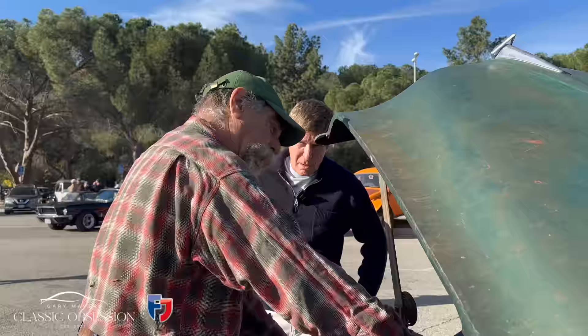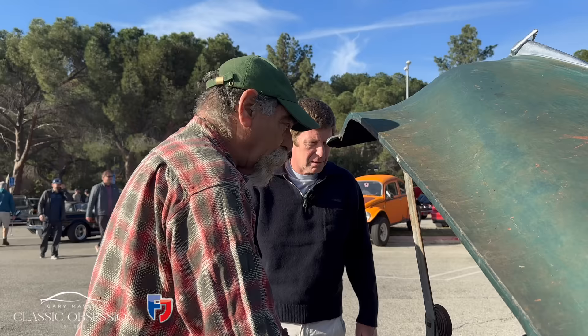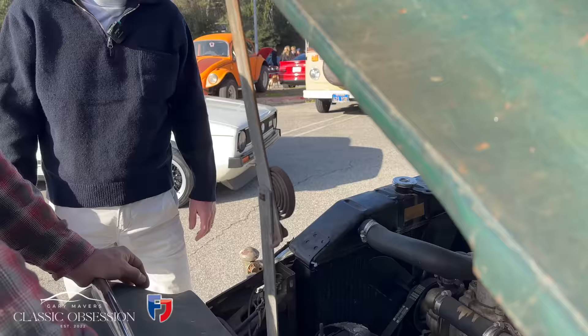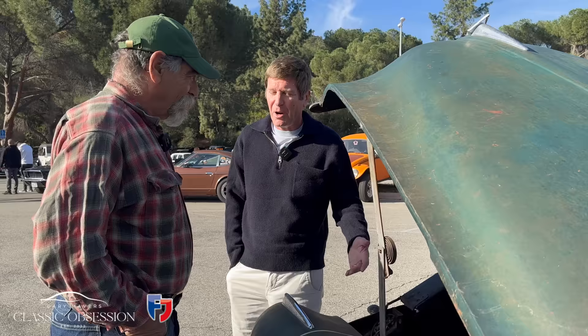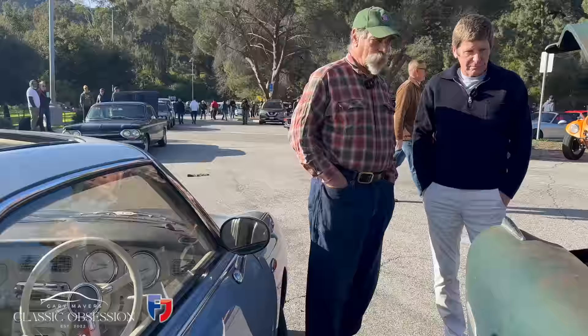When you say you went right through it, what did you do to the engine? I had to put a new water jacket on it because that one was rotted, and a new carburetor. But apart from that the lump was okay. It could use a valve job — it's a little rattly. You could probably put a little bit of treatment in there to make it quieter, or just adjust the valves and give them a valve grind. This thing hasn't had any major attention probably since the 60s — they didn't know any better, they hadn't figured out how to make them cheap yet. These are the kind of cars I saw growing up in movies. Old American cars of this period, they're not the best, but they're probably the most fun.